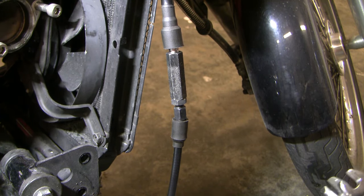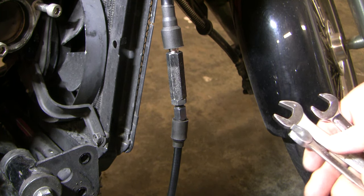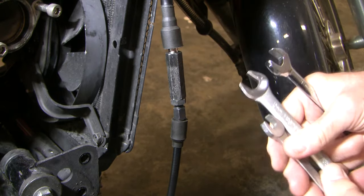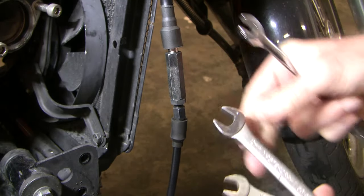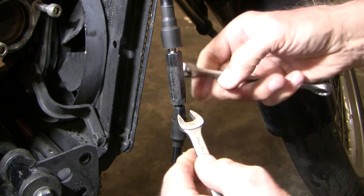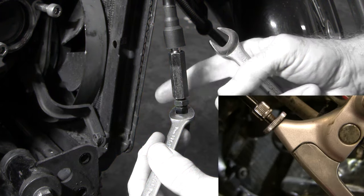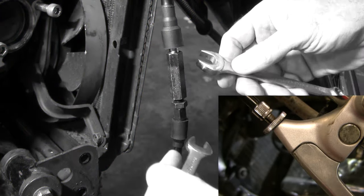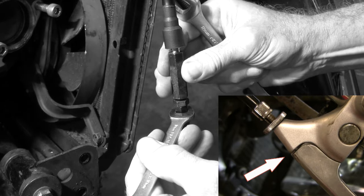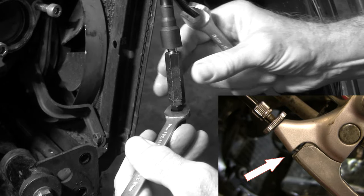There's a secret to getting this clutch undone. The clutch is adjustable at both ends but even with that it's hard to get it into place, so you're going to need to adjust this turnbuckle. This is a right-hand turnbuckle — this is the male end and that's the female end. You'll need a 10mm open end wrench and two 12s. Slide the locking nut all the way down, then turn the turnbuckle to shorten the cover and increase the slack on the cable. Now it'll be a lot easier to get undone.